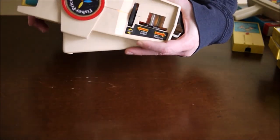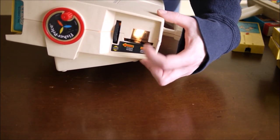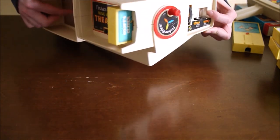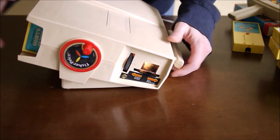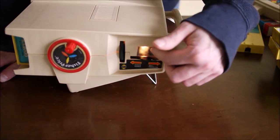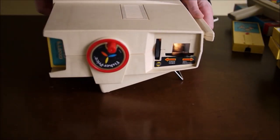The piece that broke is on the side — you can see it through the window. It rotates. You can see on this edge it's black instead of a reflective coating. So what this does — if you want to watch it on the screen, it would go on this screen. But if you turn it the other way, it's a wall projector, which comes out of this little window here. It does have a stand too. It's a little piece of a mirror — when you turn it, it takes the image and either projects it this way or reflects it to another mirror. The other mirror is back here, so it bounces off of that mirror and comes out to the window. The top just has a vent because the light bulb can get hot.